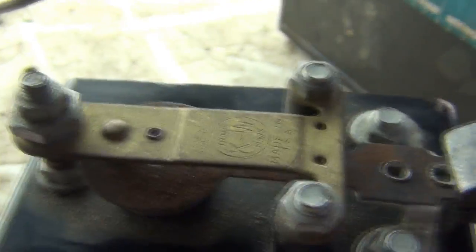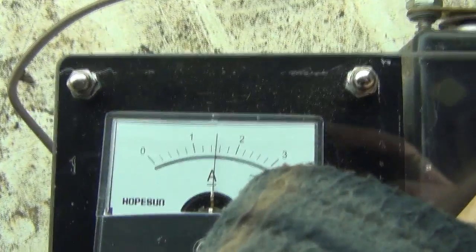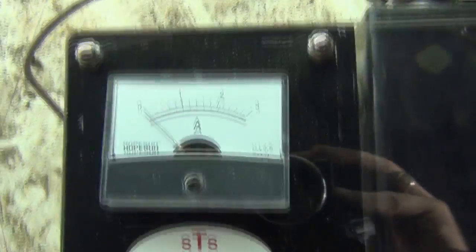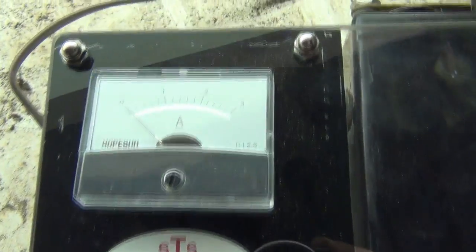Just bend that down a little bit. I don't want to do it too much. Put that back in there and give it another try. Put it against the battery. There we go. So that's now about 1.4 amps. So that's close enough — it doesn't need to be exact. 1.3 amps is the optimum, and I got that down to 1.4 from 1.8. You saw I didn't have to adjust it very much either.